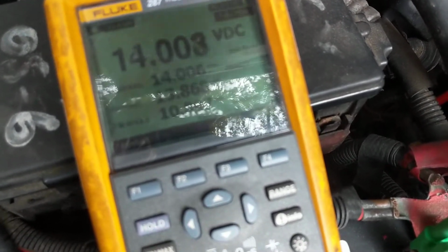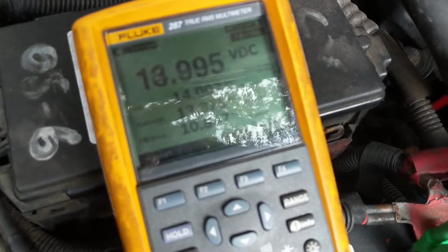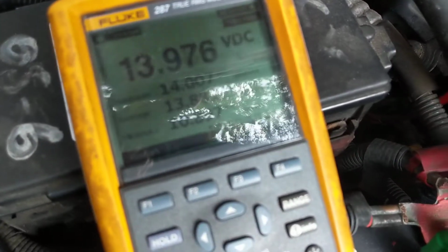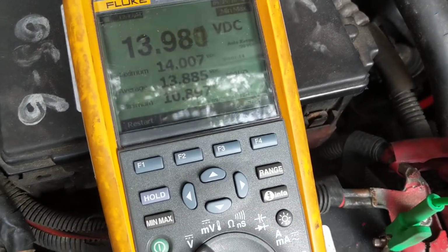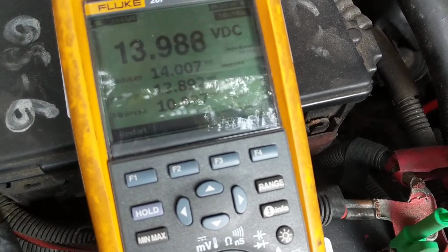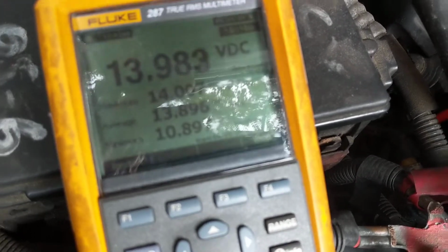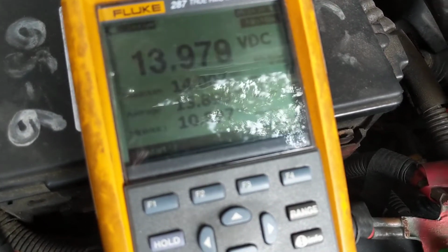That's why this type of meter that I'm stressing is the best type of meter, because it gives you an accurate reading right away. And to me, this is the best test, because now you're cranking 300 amps, 400 amps. The load tester test that I did, you're only taking 100 amps. This is the full load on it, and this shows me the true value. But obviously, if you can't start, then you're going to have a problem doing this test.